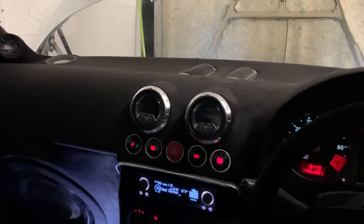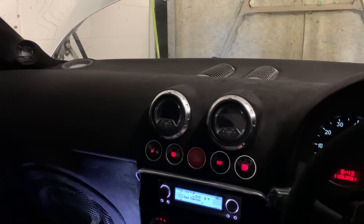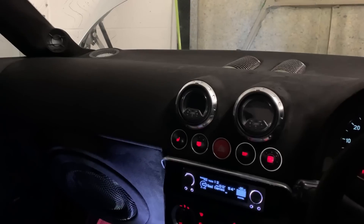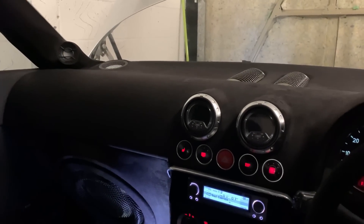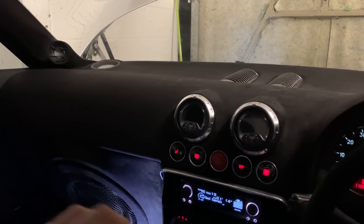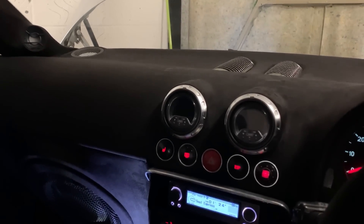When you have drivers at the dash, it's easier to get the stage further away from you, which is more believable. It's not like sitting in the cinema in the first row — same way when you go to a gig you don't want to stand in the first row unless you want to be too close. This track is for the stage boundaries — width and height. Ideally height should be eye level. If it's too low or too high you get less points. Go on emmanet.com, look up the sound quality judge book — everything is drawn and described better than I can explain here.